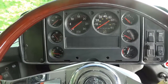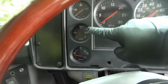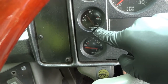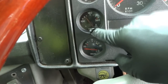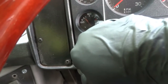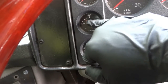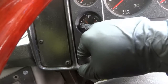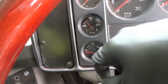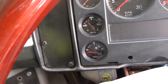I'm inside the bus right now and the bus has been sitting here — it's not hot. I'm going to focus on this gauge that says water. The driver said when the hot start concern occurs, the gauge reads all the way up to 260 degrees Fahrenheit. But right now with the bus being off, it should be sitting at 100 or basically zero. We're already reading about 150, which tells us that this gauge is inaccurate.